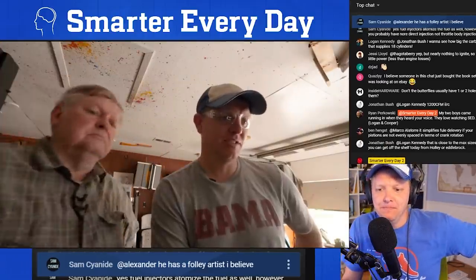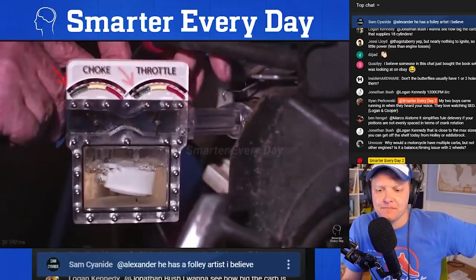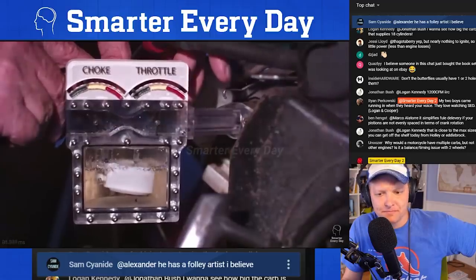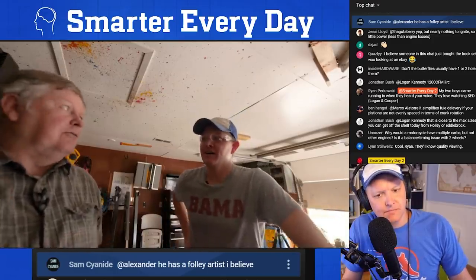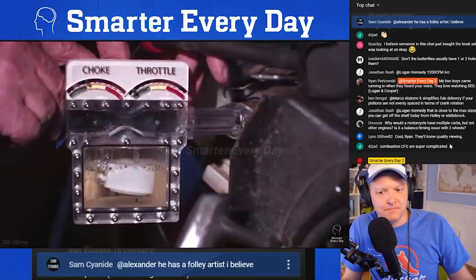What would you change on this design, like, now? I would make the controls stiffer so that when you put them in position, they would hold themselves. Okay. The engine sucks the throttle open, yes. Oh, does it? It does run away. If you don't physically restrain it, it gets faster and faster and faster. Really? There's no governor, yes. It's trying to pull that open, and I'm holding it there so that it does not, because I don't want it to run away. Right.